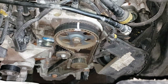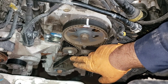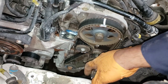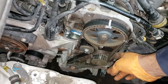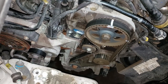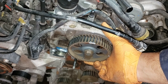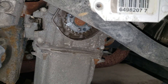With your mount bracket out of the way you can see everything. Our next step is to release that tensioner. Take note of where the tensioner guide is — this is an eccentric type tensioner so you're going to have to tension it by twisting it into the correct position. Make a visual reference in your head about where that tab is, then go back and set it to the same place. Go ahead and rip your tensioner off. With our tensioner and belt off, you can see that the mark has moved slightly for the camshaft — that's because it has a little bit of tension from the springs inside the head from the valve train. We'll just crank it back by hand. Down below our crankshaft is in the correct position where we left it.